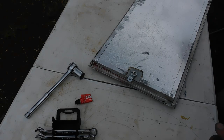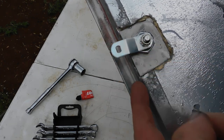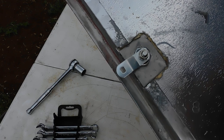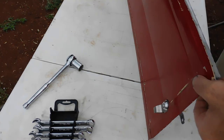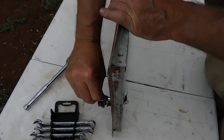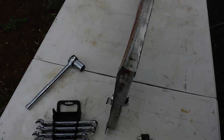I skipped a few steps in this door rebuild. This door fits very tight, and you can see I was so anxious I didn't let the paint dry all the way. But we have rebuilt the lock mechanism by taking a piece of 16-gauge steel, building a custom washer out of it, using some Loctite adhesive to secure it. We've got these new locks in here with a big 7/8 backing nut to hold it on there. We had to get in there and route that out a little bit so it would fit better.